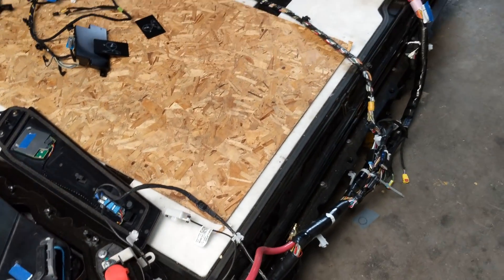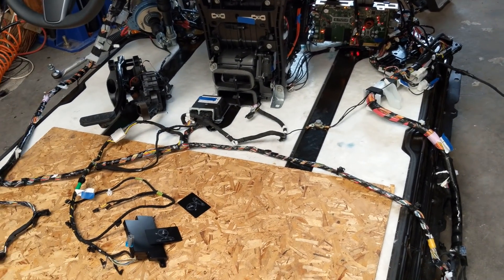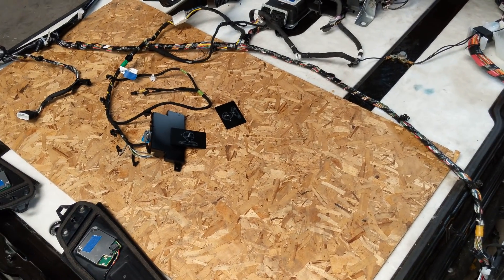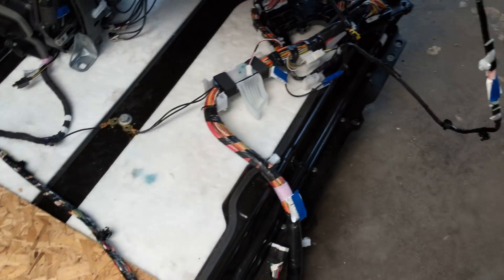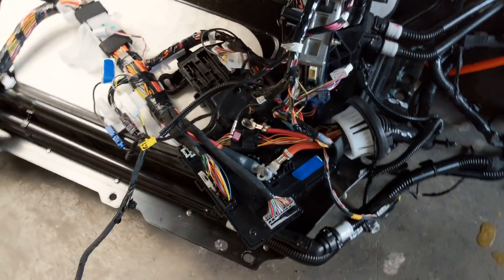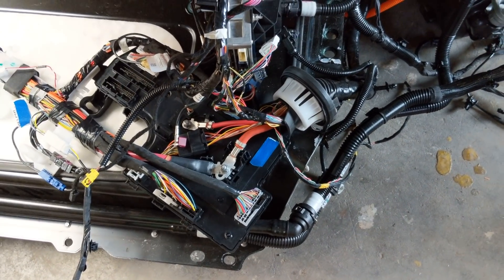Comparing this car to even a Toyota Prius, there's way less wiring, less total count of ECUs — it's simpler. They've basically vertically integrated all this thing into these three body controllers: VC right, VC front, and VC left. They contain all the functions of the car pretty much, as far as body and peripheral control.